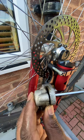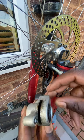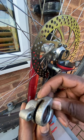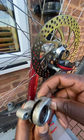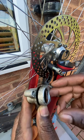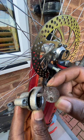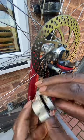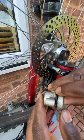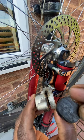Using this Allen key, it unscrews and I'm just going to remove the inner brake pad like you can see there. That's the inner brake pad but it's minus the lining, so let's get the lining out because the lining is supposed to be stuck to it. Here's the lining coming out separately - you can see it there.